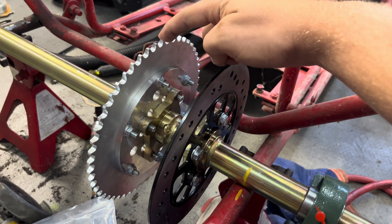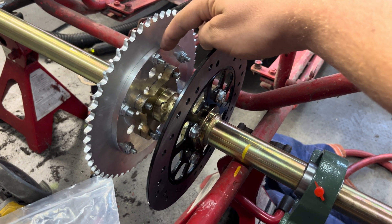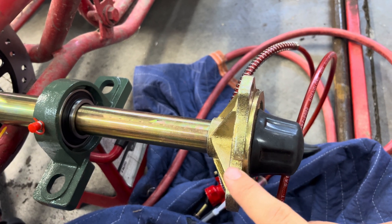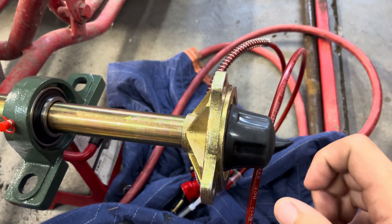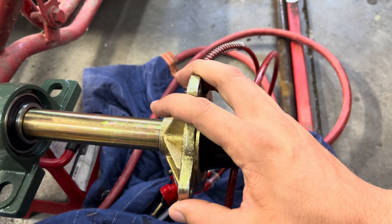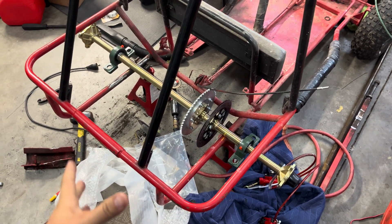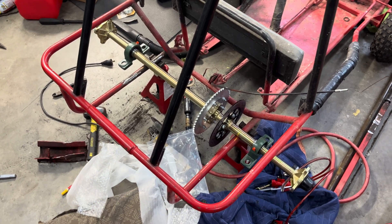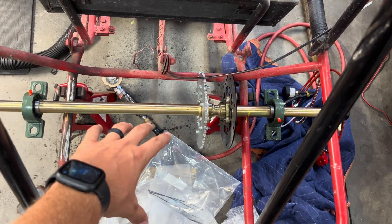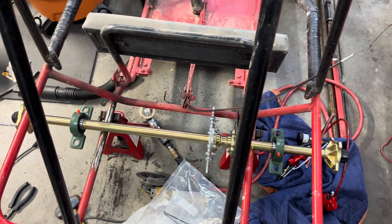I'll put a link in the description for this sprocket and this adapter. Just remember you're going to have to drill it out to three-eighths with a step bit — really easy because it's aluminum. M8 by 1.25, M10 by 1.25 — not M10 by 1.5, because even though M10 is typically 1.5 thread pitch, this one is 1.25, so it's a fine thread. If you have any other questions, let me know. I'll try to post another video after I get everything bolted in. I'm going to have to mount the engine over here, probably run a jackshaft underneath to power that sprocket so the engine's facing the right way. I'll put links in the description. Thanks for watching.